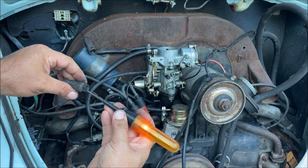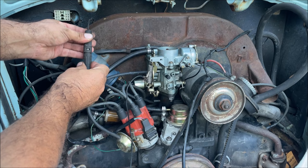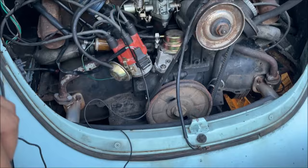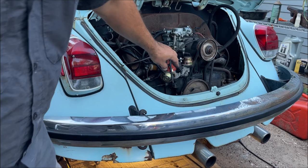That uses the bullet fuse, a white one - there's a little window there. Now we should be getting power up here. One of these is actually hot, so then we should be getting power at one of these down at the switch. With the new switch installed and tested, when we touch these we'll have reverse lights.